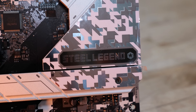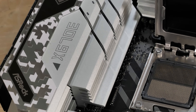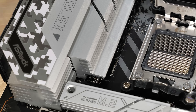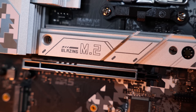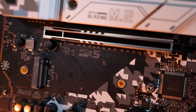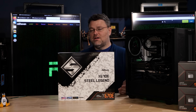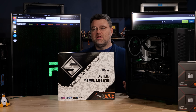The motherboard's not really the bottleneck. That said, this motherboard does have more than adequate aluminum cooling for its VRM solution, as well as its PCI Express 5.0 M.2. This M.2 connects directly to the CPU and has a substantial aluminum heat sink, and it's physically located just above the primary X16 slot — which is also PCI Express 5. Some X670 motherboards give you two PCI Express 5 slots operating in x8/x8 configuration, but this board will always operate that slot in X16 mode.